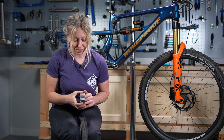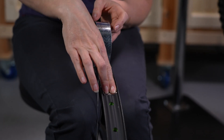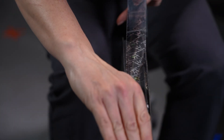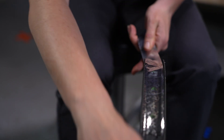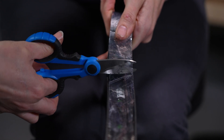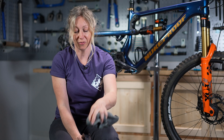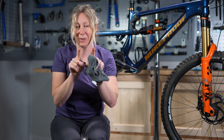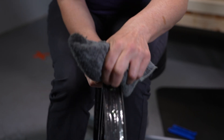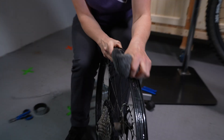My biggest tip is to start over the valve and go all the way around once, then come back over the valve so the valve gets double but everywhere else gets single. However, if your tyres sit a little loose on your rims then you might want to go twice around the rim to give a little bit of extra sealing. Finally, get yourself a dry cloth or sponge and rub it all the way around the tape, pushing down firmly on the shoulders of the rims where your tyre is going to sit — make sure that is sealed before you go any further.